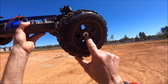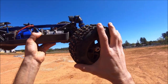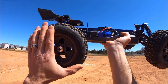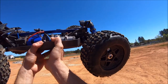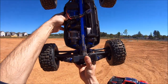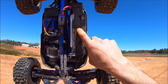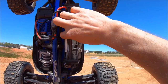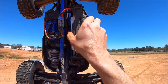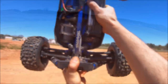I'm still running the Backflips on here. I did go to the M2C universal hexes, plus five millimeter — this is just temporary, it does have a little bit of play in it, but I just wanted to run these Backflips to get a little extra width out of the truck. M2C does plan on making an actual hex for this truck so you can run the stock tires as well, so look forward to that. It does give her a little bit wider stance — 10 millimeters all together. The HRB battery, 5200 milliamp 100C, is kind of a short pack but super fat, so I had to turn it sideways and put a piece of foam there to lock it in. Running a 15-46 gearing — we'll see how she does.